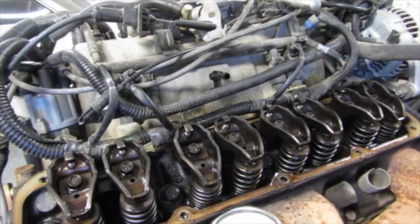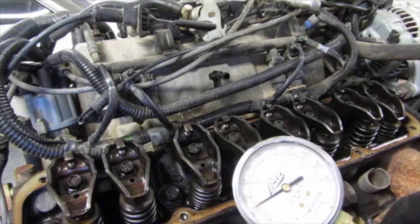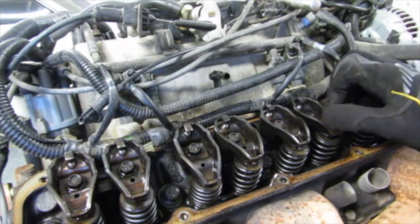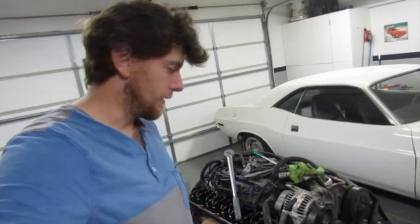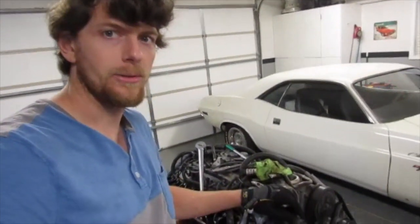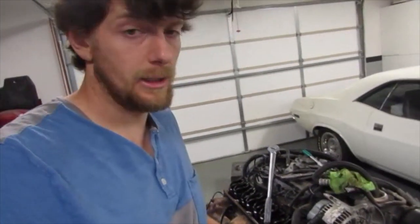Oh yeah, same thing. So, a little thick Lucas oil mix helped that, but it was definitely burning oil, so it's going to need rings, bearings, all that stuff. I guess the $1 million question is, do y'all think I got a good deal on this one? 96 model, supposed to have 109,000 miles. You saw the plugs. Turned over smoothly, but I would definitely rebuild it before sticking it in something.